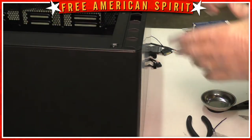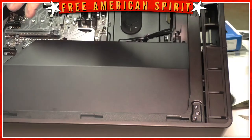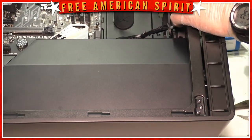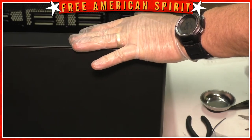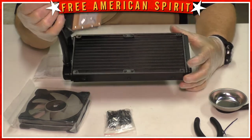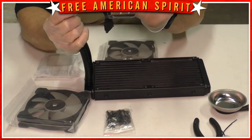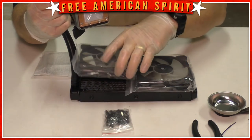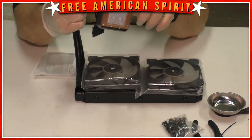Step six is installing the water cooler. Because it's a larger radiator-type cooler with two fans, I looked around the case and determined the fans will go on the bottom, drawing air up through a filter. This is a pre-sealed liquid cooling unit — water circulates through the pump to pull heat off the CPU. The two fans mount just like this, and long screws go through the four holes of each fan and through the radiator. I haven't removed the protective cover from the pump head yet — it has pre-applied thermal paste. Make sure you remove it right before seating it on the CPU, or it'll burn and cause damage.